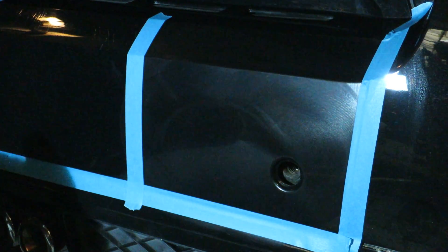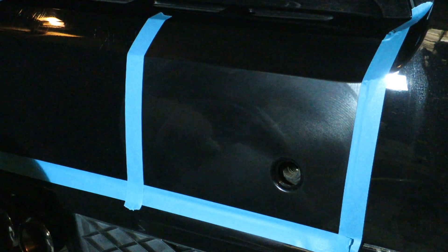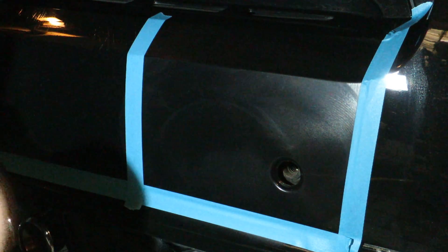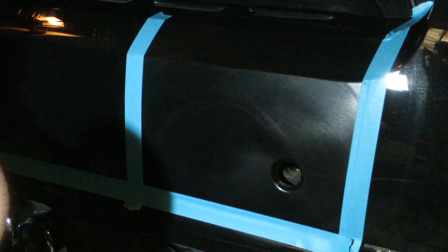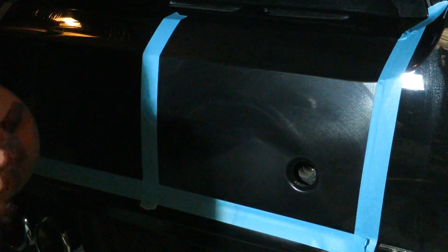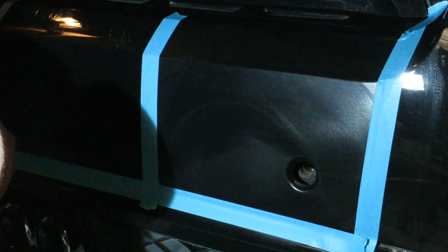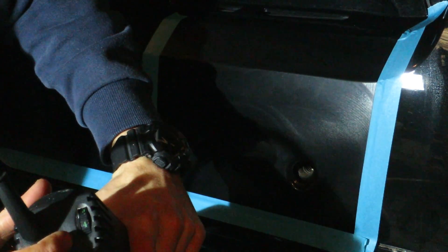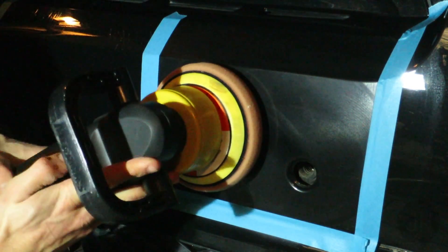Once that's worked in for a good set, take a little bit of pressure off. Use a green microfiber towel to towel the pad so any residue comes off. You can do that with a utility brush as well — just give it a light brush off, or if you've got compressed air, shoot the pad out. Now with the pad clean, turn the machine down — so that was on three and a half to four — turn it down to just a three, and find the surface again, same procedure.